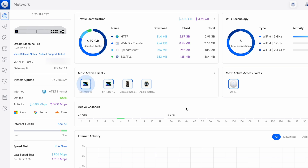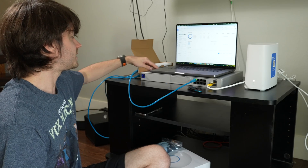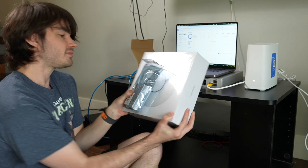So far I've established several key things: forwarding the WAN IP from the modem to the Dream Machine, and configuring the Dream Machine to accept the AT&T network connection while keeping it on the 192.168.1.x IP track. That way all my home devices stay on that subnet and I don't have to reconfigure everything. The Dream Machine Pro doesn't have a built-in access point, which is why I got the separate UniFi access point.